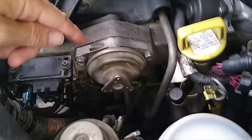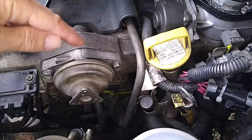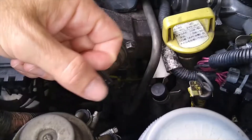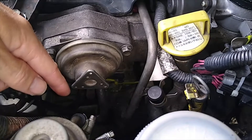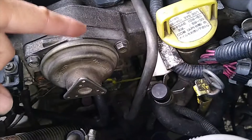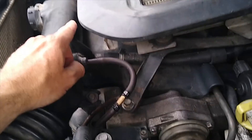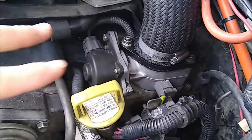But don't panic, there is hope yet — you can stop this happening. There are three options. The first one, and the most basic easy one to do to give you an immediate response, is to disconnect the vacuum pipe off the bottom of the exhaust gas recirculation valve, pull it off, and block it. You have to block the pipe that leads away, because you'll start to throw fault codes in the engine management system. Once you've done that, this isn't going to work — it's not going to pull the plunger out of here and let exhaust gases get in. I've run that mod, just by disconnecting this, for the last ten years and I haven't done anything else. I haven't blocked off the intake where the exhaust gases come from over on the manifold, and I haven't removed the butterfly plate out of the throttle body in here. There are two other items I'll come to later.